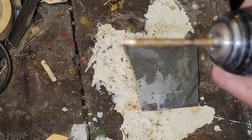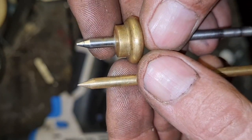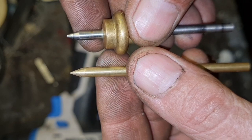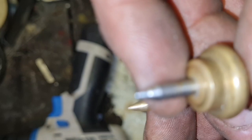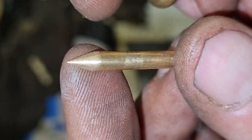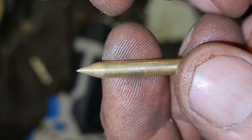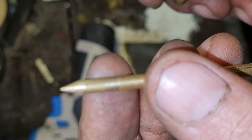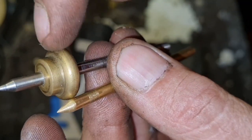There you go - that will go on that seat nicely. So we'll take him out the drill and there we have our point we've put on that bit of brass - nice and shiny, no gouges. In fact that's better than this original steel one which over the years has actually worn a ledge in there. All this basically does is it fits in a slightly tapered hole, so it's very crude fuel metering, but it'll work. So what we're going to do now is press this collar on to get the height right, and then we should have a completed float needle.